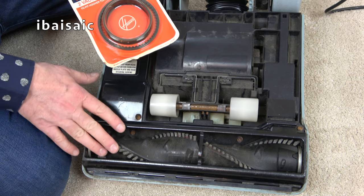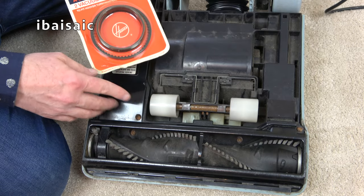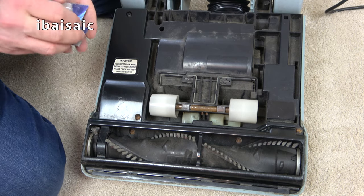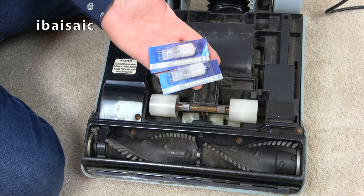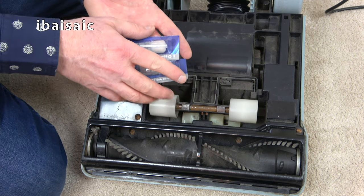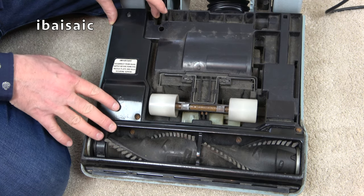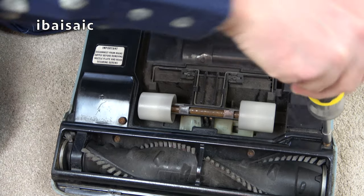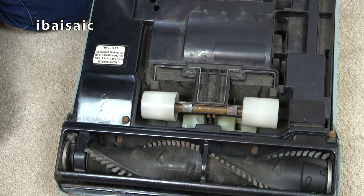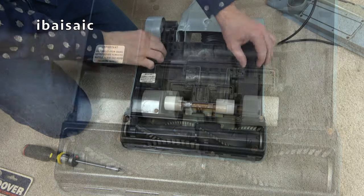This is how the machine can be used for hard floors — you can turn off the brush roll. It's got the same motor; it's not a separate brush roll motor. All the switch on the top does is move the belt over to a pulley system to stop the brush roll rotating, and that also works when the machine is upright. I've also got a new bulb — one's a warm white and one's a cool white; these are G9 capsule bulbs. I'm going to see if they'll actually work to replace the genuine Hoover ones. I'll undo two screws here to remove the nozzle plate and then some more screws to remove the motor hood. There's a little bit of rust on the screws — I think I've got some screws salvaged from a Hoover Turbo Power if they're the same size.